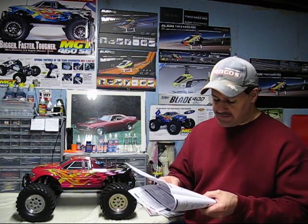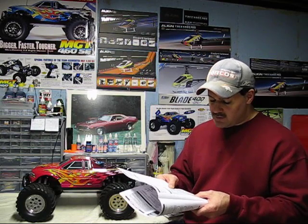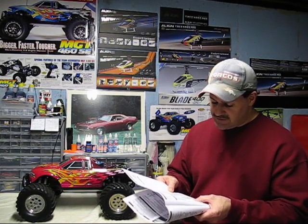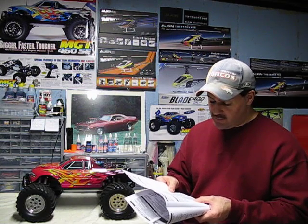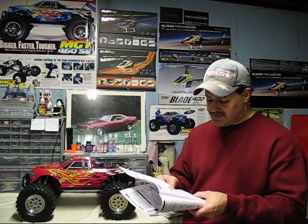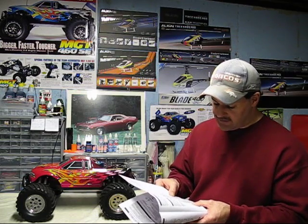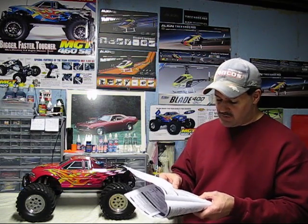The engine overheats. High-speed fuel mixture is too lean. Richen it up. Cooling air is being blocked. Okay, to the head. Make sure the head is getting enough air on it. Could be excessive nitro fuel. You just could have too much in that particular gallon you bought. Excessive load on the engine. Check for any kind of bound up, any kind of weeds or anything in the drivetrain. And if it's overheating, the low speed mixture is too lean. You've got to richen up the low speed also.